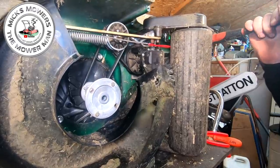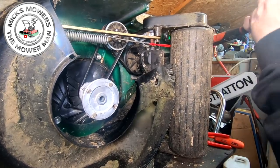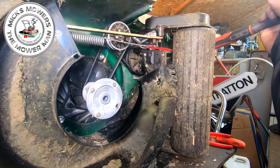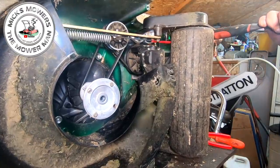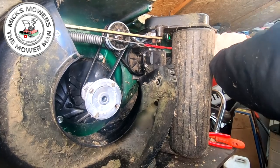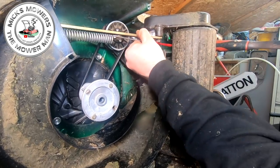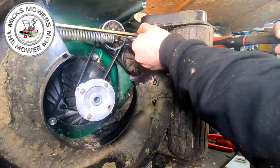And then once you get to a certain point, like there, you can then pull the hammer back onto itself. As I say, there's a lot of tension there, people, so you have to go a bit easy. Might want another turn on there, Mick, like that. And you can see we're nearly there now. So all you want to do is get the hammer in the right location, which is going to be about there. And now I can pull that and pull the spring over, mind your fingers, over that post.